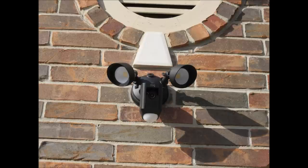Hello guys, Lifehackster here. If you're having connection issues, delayed response and alerts on your Ring cameras, you might have a Wi-Fi connectivity problem. Last week I installed my Ring floodlight camera outside the garage, behind a brick wall and a metal garage door, and I had problems connecting it to my Wi-Fi. I actually cannot find my Wi-Fi if I'm outside and the garage door is closed, so luckily I have an old Wi-Fi extender which I installed inside the garage, and that's the only place where I can get a good connection and my floodlight camera is able to connect.